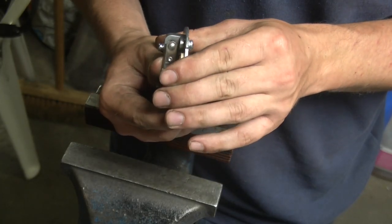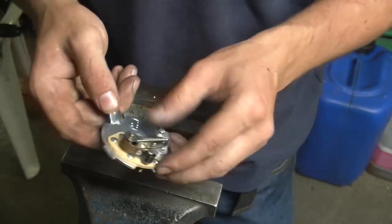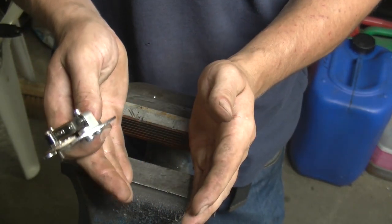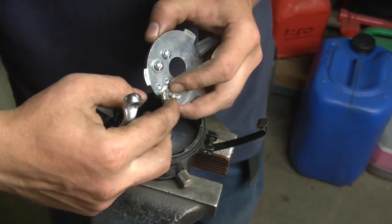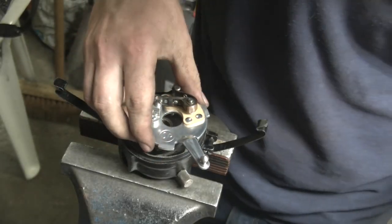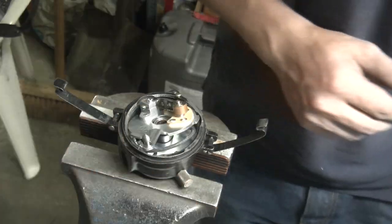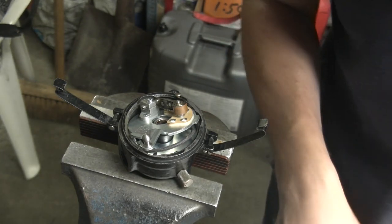Not a whole lot of movement, and when I look at the height, the center of the point to the center of the other point, that will be fine. There are types where they don't line up, and the only way to fix that, if you're going to go with this setup, is to put shims, or whatever you want to place there, so everything lines up, because you do not want too much of a difference between them. Some you will be able to get away with, but it is better if everything lines up. Okay, we got full travel, then we are in the position to install a spring.